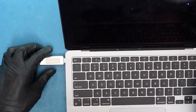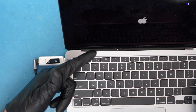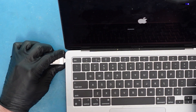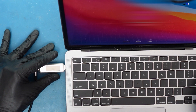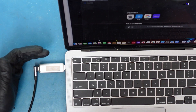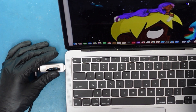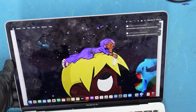Look at those beautiful ports. Let's plug it in — you heard that click, so satisfying. We actually get power; the Apple logo is coming up. Swapping to the other port — it's charging, getting 19.5 volts and about 2.36 amps. Both ports are charging, which is great.